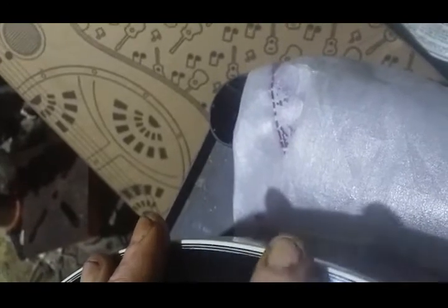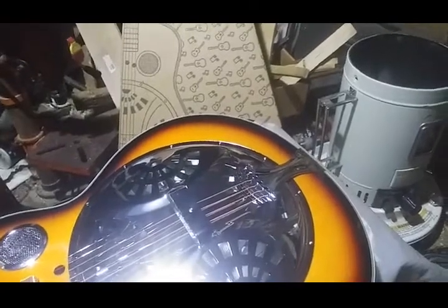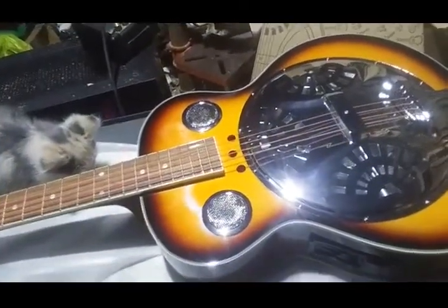One little flaw. And that'll probably sand right out. You'd sand that right out and just take a little clear coat on your finger and it's gone. Come in with like 2000, probably a little on the fine side. You might have to go down to somewhere around 400 to 600, something in that range, in order to cut it without making an all-day chore or burning through an entire sheet just to do that little spot. So, when I post this, y'all help me out and tell me what these holes are for.